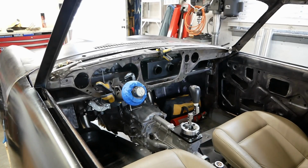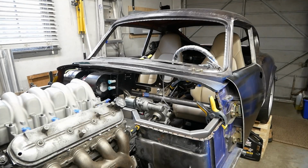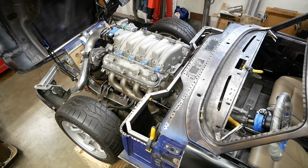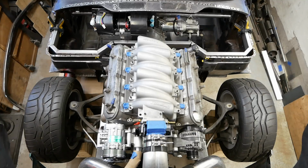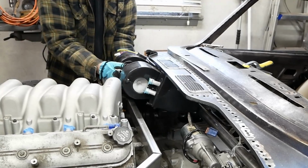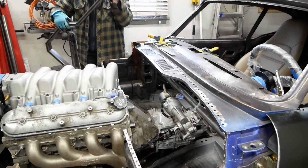And it's turned out the factory dash could still be useful after all. The evaporator core may just need to sit further towards the passenger side, but there should be clearance to the rearmost exhaust manifold bolts, and on the whole, it's an attractive enough package that should work well if we can make it happen. The back of the 1x2 is currently set up with an 1/8-inch gap to the A-pillars for some strengthening plates. So let's rip it all out again and get things finished up.